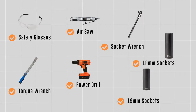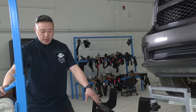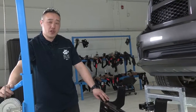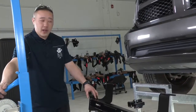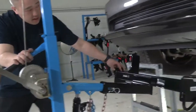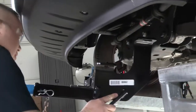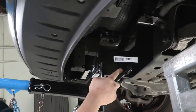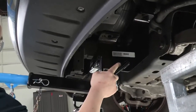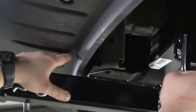You will need the tools seen here to complete this installation. We've got the hitch on our U-Haul exclusive hitch mounting rack. If you don't have one of these at home, you'll probably have to get a second pair of hands to help you with this. The hitches are heavy, so you do want to be safe while you're doing this. We'll be sliding this in towards the vehicle, getting this lined up. What we'll want to do is just get this into position so we can find our notch points, because we will have to trim the front bumper here just slightly to get the hitch to fit into place.